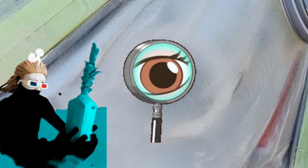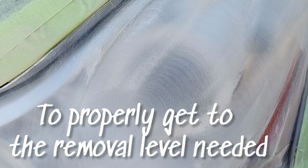But I could tell, with this light being the size that it is and the level of degradation going on, it would take probably anywhere from 3, maybe 4, P500s. To alleviate that, I'm beginning very lightly, even lighter pressure than I normally use, and that's also why I'm using the double stuff method on this, just to help back off some of that pressure. Believe it or not, that double stuff helps you control your pressure a lot as well.